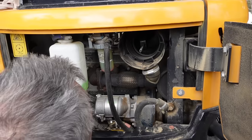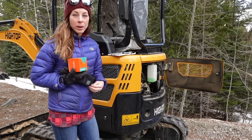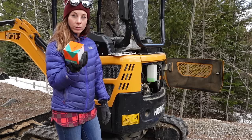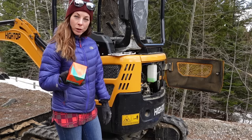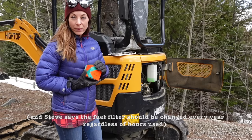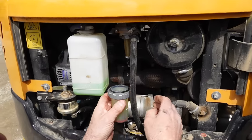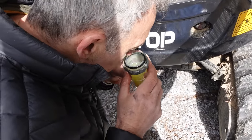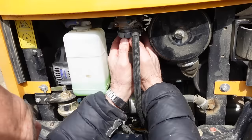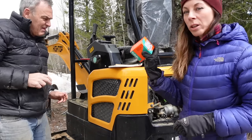It's unlikely there's something stuck in the way of airflow, but we're just looking at the fuel system now. We're going to start taking it apart piece by piece and see what we find. We're going to change the fuel filter on it regardless, just because it came with some fuel in it and perhaps that fuel wasn't great, or maybe we put some bad fuel in it. We're not really sure, so we're looking at all the different aspects. Taking off the water-fuel separator — there's a little screen in there and it looks like fuel.